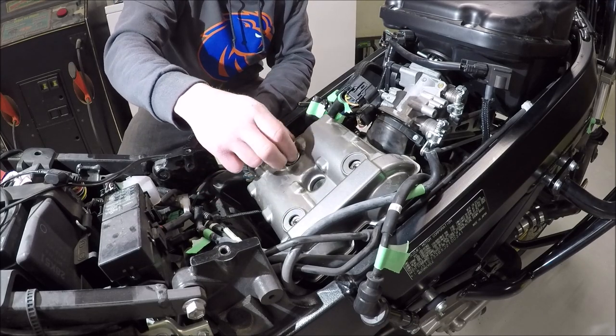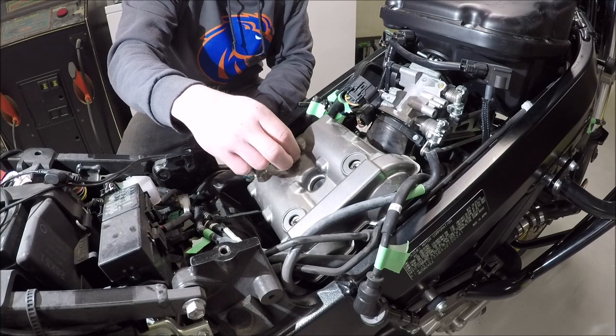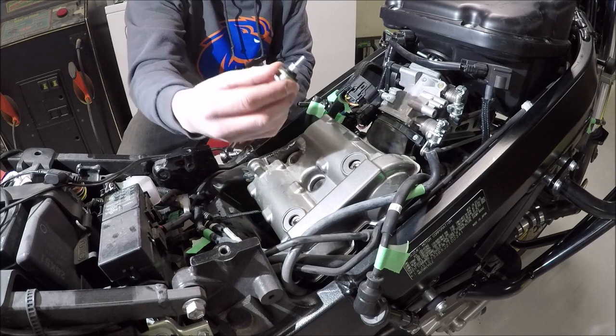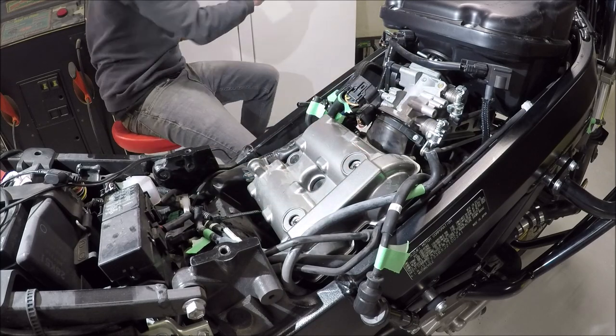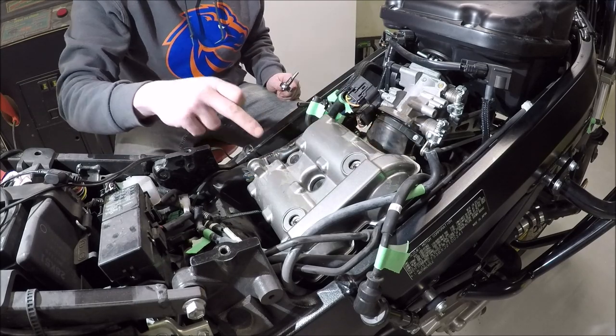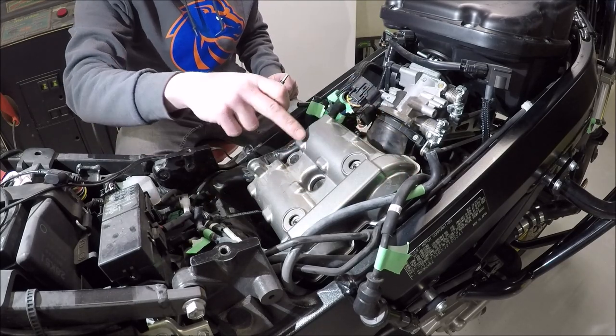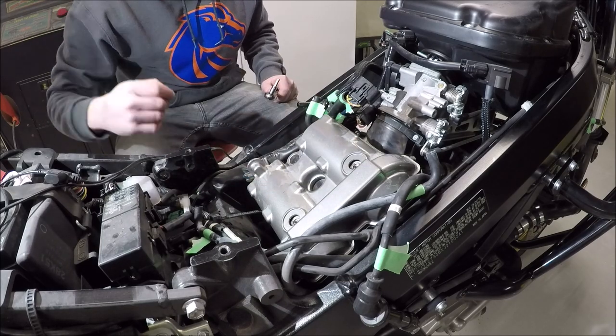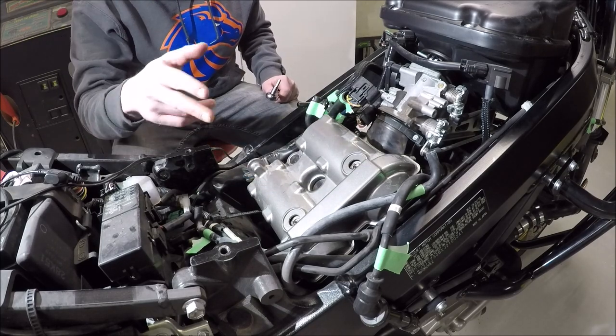There is a little rubber gasket under these bolts, and this one on this side is a little bit different than the other two. When we reassemble, something I should mention — we do want to put fresh motor oil on the gaskets when we reassemble, just to help it seal. I'm going to have to go get some of my Rotella.